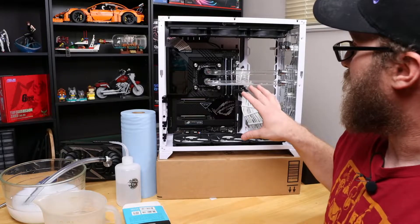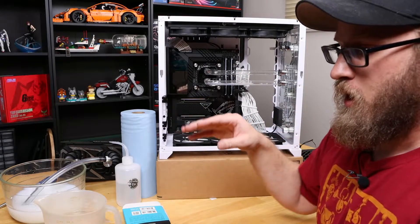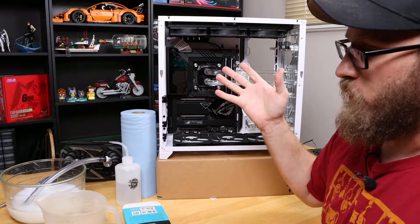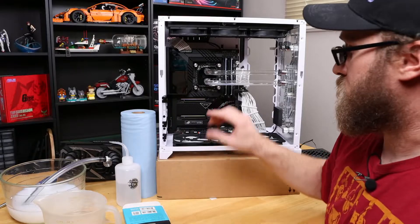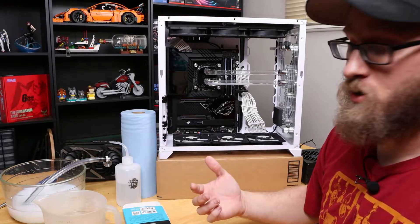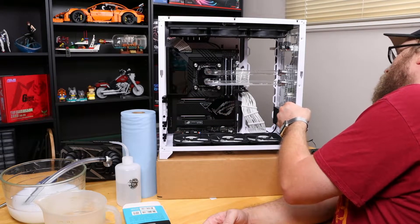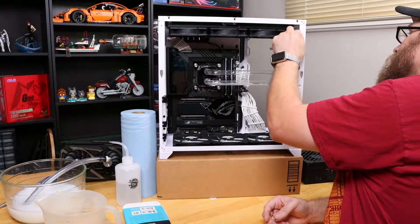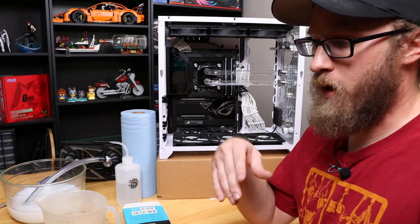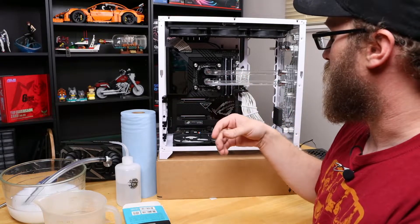Now that we got as much of the distilled water out of the radiator and the tubes by twisting and moving the system around, what's left to do is fill any spot that has a fitting for these tubes with shop towels or rags before we start removing the tubes. There is still distilled water left in here, but the nice thing is if we cap it all off, none of it should leak into the system, and that way we can pull apart the system and get all the distilled water out. I'm going to focus on lining everything with paper towels and getting these tubes off so we can get the motherboard out.